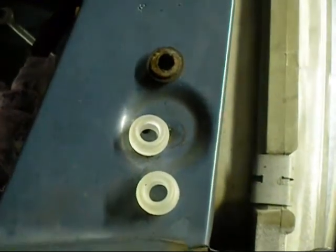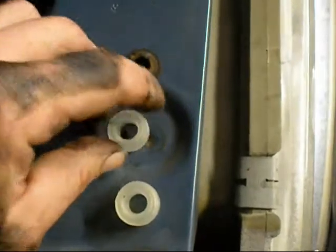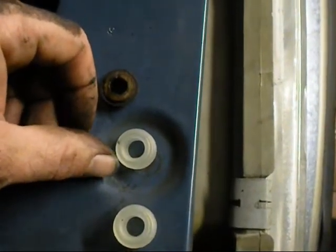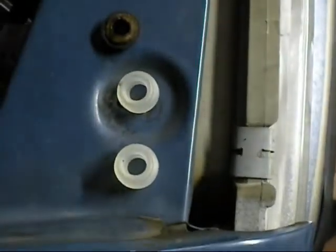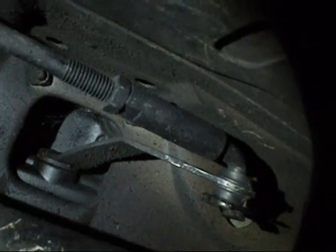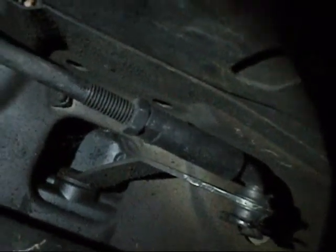I noticed that the gear selector in this car was awfully sloppy — didn't feel like it was connected to the gearbox quite well. So I pinged the gear selector bushes — that's what these things are. There are two of them on the rod underneath, and that's all that was left on the rod: half of one of them. So it wasn't doing anything. It was almost at the point where you couldn't get it to go to park — it would stay in reverse even if you put it in park. When I get these in I'll show you where they go. They were both missing, so it didn't really feel like the selector was connected to anything. It's not very good for the gearbox to be half in a gear, and it's kind of dangerous because you might try to put it in park and get reverse. That's all fixed now.